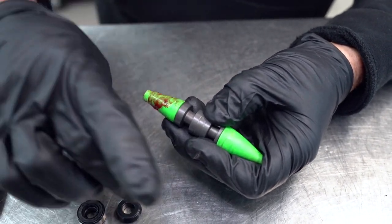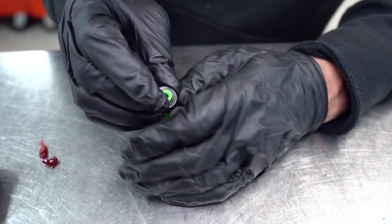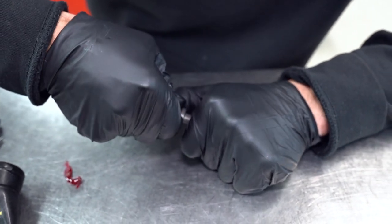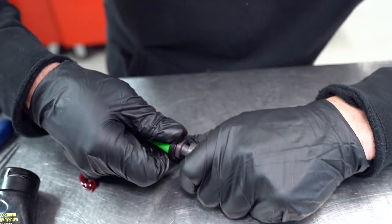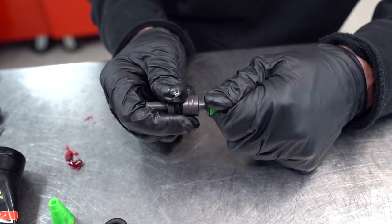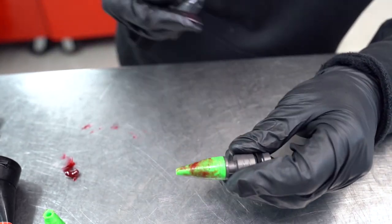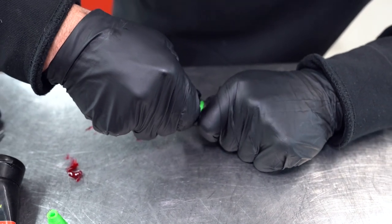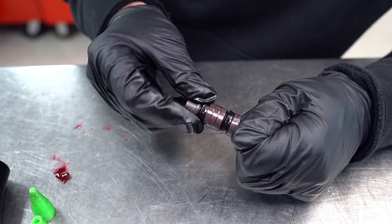Put a little bit of grease onto the little cones, then get the seal and slide it down and on. It's way easier because it just slides right up over that lip — still not super easy but way easier than trying to stretch it the old-fashioned way using the rounded-off pick. Clip it in like that and then remove the tool. Remember that both seals are going to point in the same direction — you don't want to get that wrong otherwise you'll be pulling them off and sticking your new seal on again. Put a fresh coat of grease over the seals so that when you put it into the master cylinder it all slips in there nice.